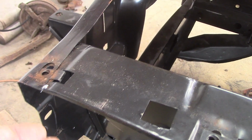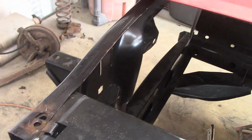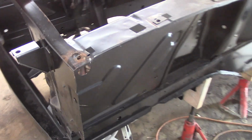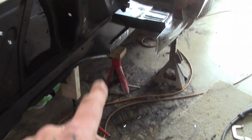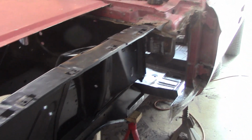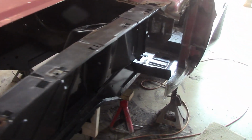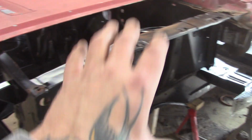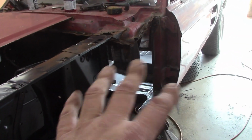Now I know it's 1/8 of an inch, so I'm just going to bring her out 1/8 of an inch, do another spot weld like that, put my fender on, slide my hood over, and hopefully that's going to work. But everything right now you can see, jack stand, jack, everything is just mocked up in place. I never just start jamming it in there and welding and going to town on it. I just don't. And then once I get this lined up, then I'll weld this in so I know it doesn't move. Then we'll start messing around with that whole shit show over there.